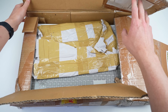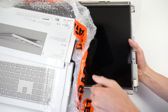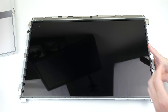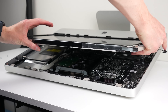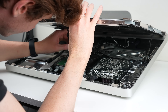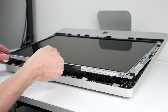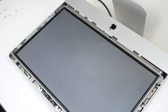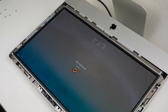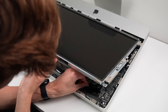After powering on the computer, you can see the display exhibits the same issues as before. With the cable not the culprit, I'll need to replace the whole display. $108 later, I had a used one. There was no images of it turned on, and with only one poor photo of it, I didn't really have any idea on what condition it was in. Pulling it out, it looks great with no scratches. It even came with its mounting hardware and cabling, so it'll be a direct replacement. I'll test fit the screen to make sure it and the iMac is working before proceeding to complete any of the upgrades. Firing up the iMac, you can see it now displays the correct image and we can actually see what's going on on the computer.